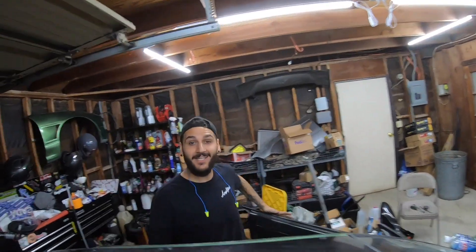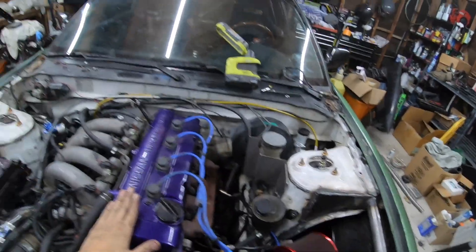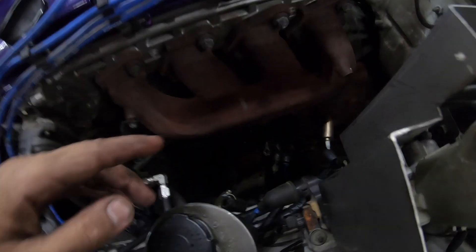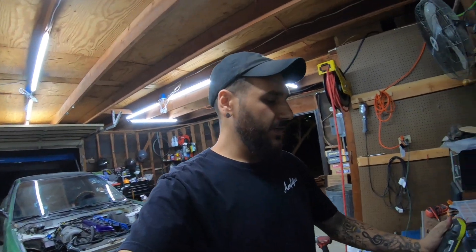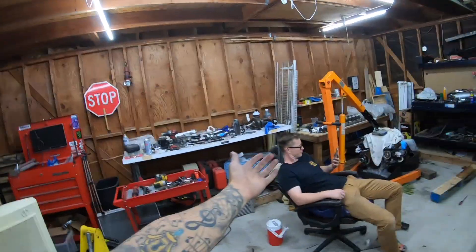Now before I blow it — there's no radiator fluid in it. I kind of forgot about that. All right guys, it is 1 AM, we've been at this for a while. It runs, it sounds good. We just finished bleeding the clutch and bleeding the power steering. I think — I don't want to jinx it — but I think it's not leaking down there at that blue fitting, which would be a very big blessing. Also guys, if you haven't subscribed to Donald's YouTube channel — The Drift Realm — please do, we are a combo team of YouTubers here.